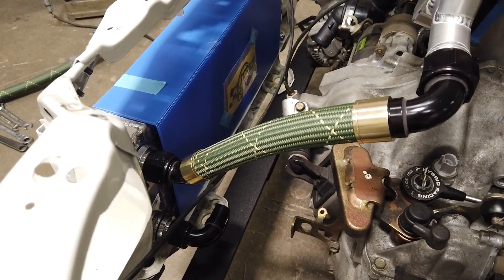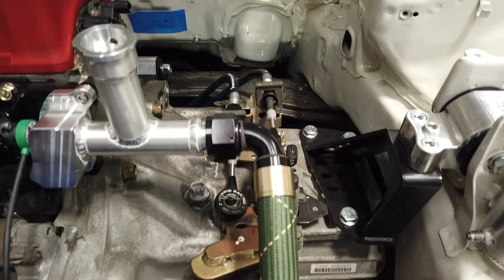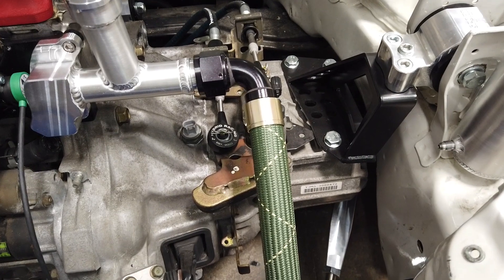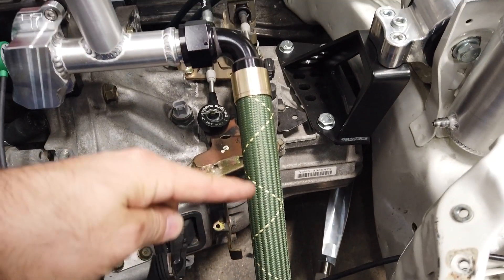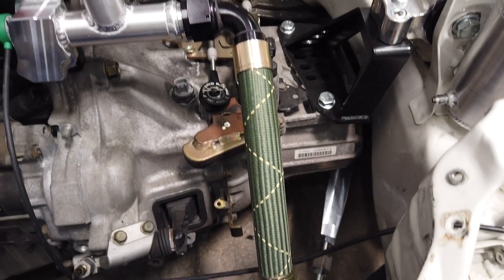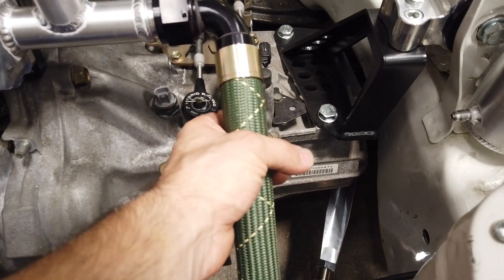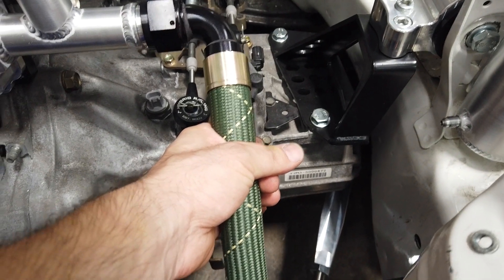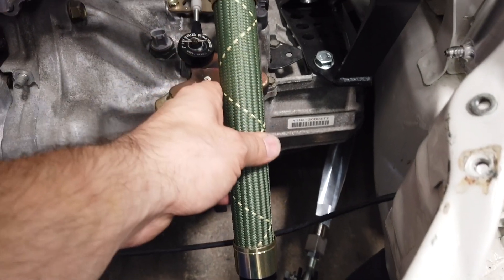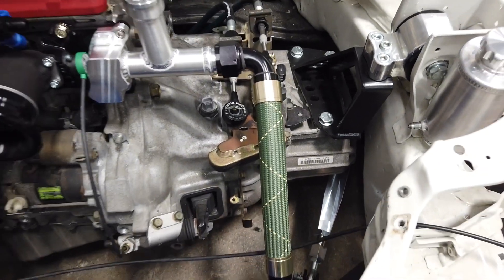As you can see, it turned out pretty good. I didn't actually end up trimming anything extra off of it. One thing I could tell you as kind of a heads up if you're doing something like this — the best way to have plumbing is to not have anything that's too terribly tight or binding. Line length is always going to be in your favor, so try to build stuff with hose ends with the longest possible line so there's the most amount of flex possible. Trying to build stuff with moving parts — a dash 16 hose like this is quite big, and even though this line is extremely flexible for what it is, it's still not flexible at dash 16 or 20. So always build with a good amount of line length; it's a lot easier to work with and in the end you'll have a better product.